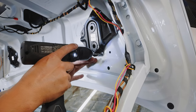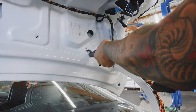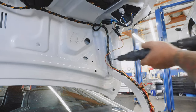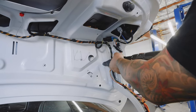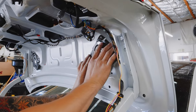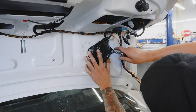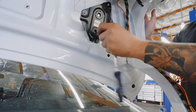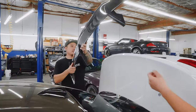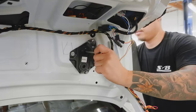During this process, make small incremental changes until the bracket slides in flush. This is the part that takes the longest, but if you want a leak-free install, without the bulge where the bolt passes through the trunk to the wing, you'll want to ensure the bracket is properly seated and anchored in. Then we can loosely assemble everything else before tightening it all down together. This will create an airtight system with our gasket washers as the actual seals. The last thing we want is a leak in this area.